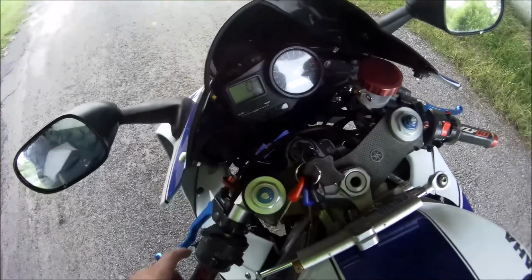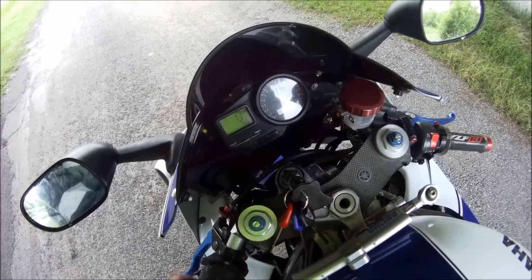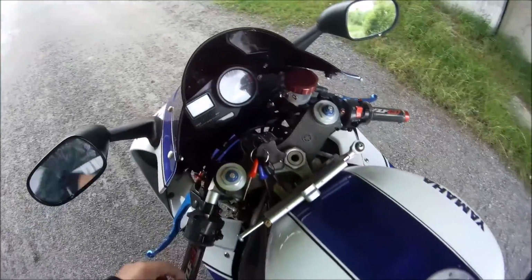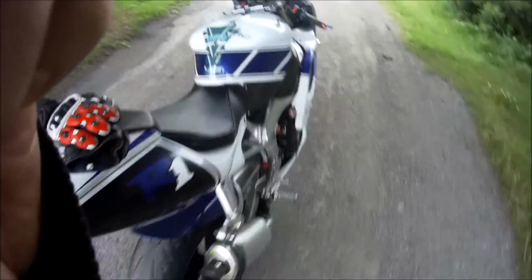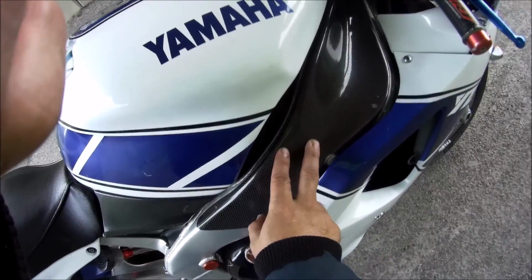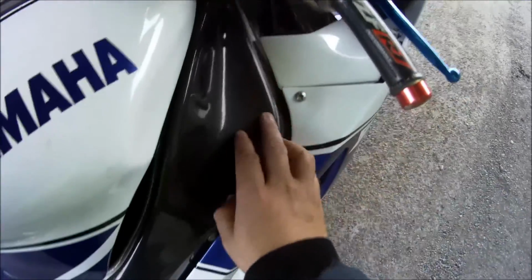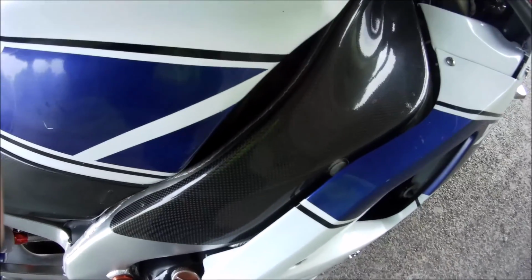If the bike works on the pass light but nothing else, that is a sign that one of the connectors is off. Now if you take off the petrol tank and the airbox, there's a wire just behind this here which comes from the headlight, comes from this switch here and comes back down along here to here. Check that, that's where the problem was.